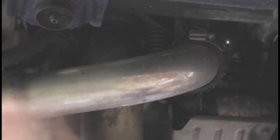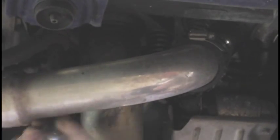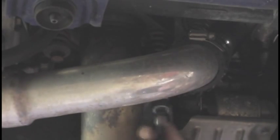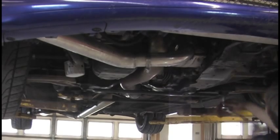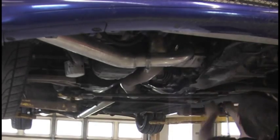As you can see here, we're going to loosen the bolts from the downpipe holding the downpipe to the O2 housing. To get the exhaust far enough out of the way, we're going to remove both crossmember bars. I only showed one in the video but I did remove both of them.